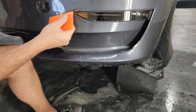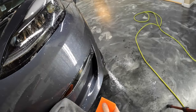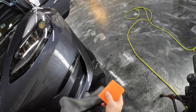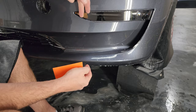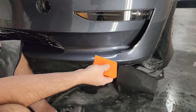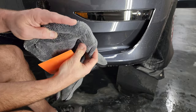Okay, and if you got an area where fingers keep popping up, you can also take your towel and dry them out. Just go to the edge and then follow it right up with the towel and get that moisture out of there, and that'll really help that edge stay down because it doesn't have the moisture. If the moisture is sitting on the edge, it'll actually run back in there a little bit. It'll loosen up that edge and go back underneath the material. So if you're having an area that doesn't want to stick down real easily, then go ahead and dry the edge off with a towel.